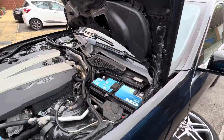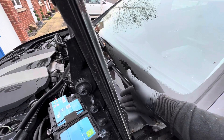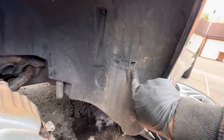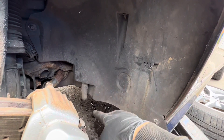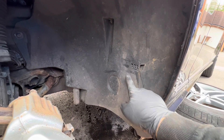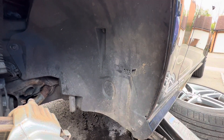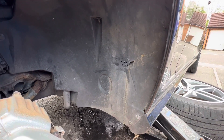We've done this side, so I'm just going to do another test the same as the other side. We'll pour the water on the windshield as normal — it should drain into the scuttle, down through here, down through these drains, and come out the normal triangular hole which I've cleaned out, along with the collector. Same for the other bonnet drain — I'll show you that working as well. We've got the same modified six holes in it just the same as the other side to help. Some people have cut these collectors off and put a longer tube routed out the bottom, but I think they should still work as long as we keep on top of cleaning them on maintenance services.